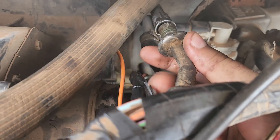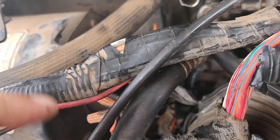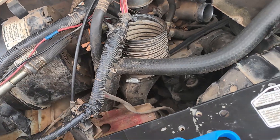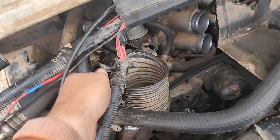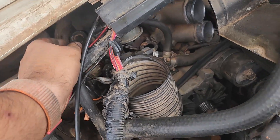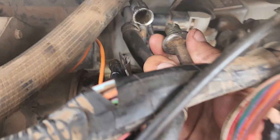The last step of course is to reconnect this line. I'm going to be honest — it was not easy. It actually took me a couple of days of struggles to get it to lock back in place. I had to kind of slam it in there and feel that lock. You have to hear the click and verify that it is locked in place, because these AC lines, you can't just pull them out by hand. If you could, the pressure of the refrigerant is going to cause them to break open — and you don't want that when you're fully charged, the refrigerant will go out all over the place. I did eventually get it to lock in, but it was very, very difficult. These lines are just a total pain, but I hope that you have more success with them and they click in nice and easy for you.